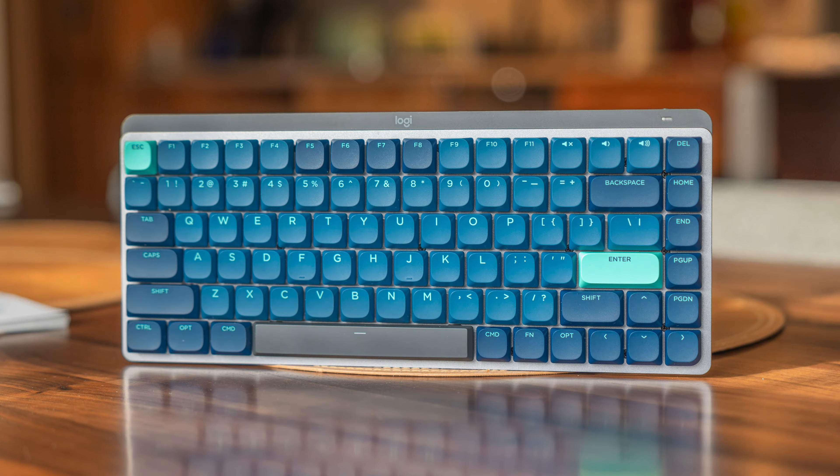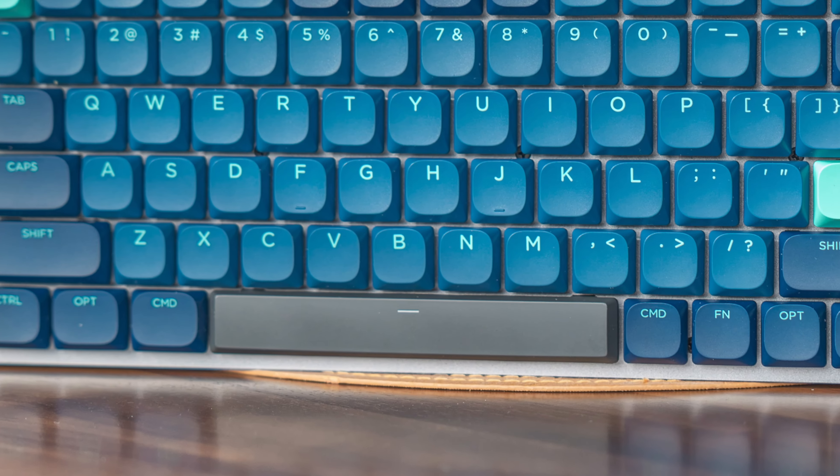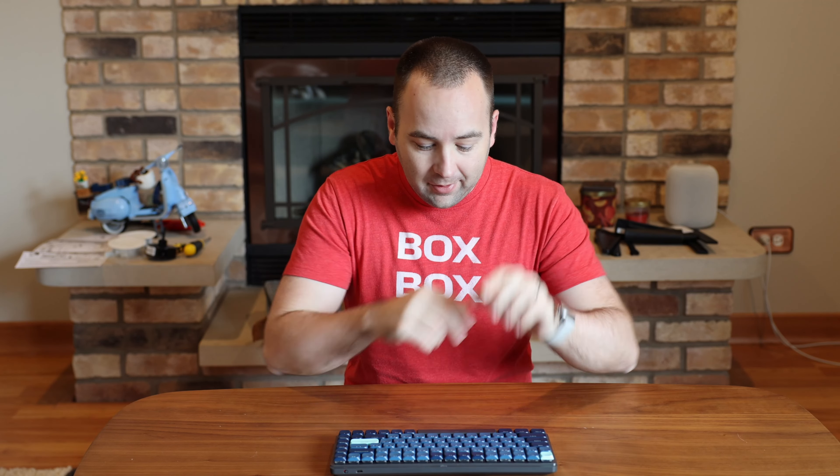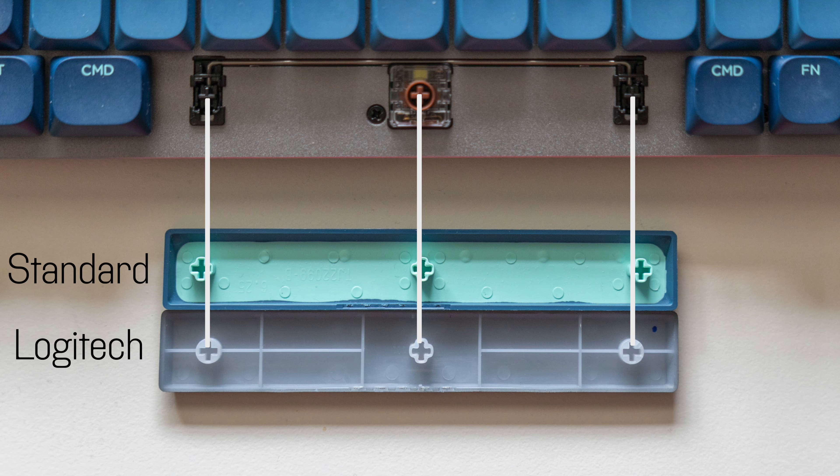Maybe you're okay with the switches and just want to change the keycaps. I've changed the keycaps on here, and it makes the keyboard look a little nicer and more to my personality — but if you look close, the space bar is not quite matching up with the rest of the keys, because you can't really change the space bar. The stabilizers underneath it are not standard, so when you buy a new keycap set, every key goes on fine except the space bar. The space bar and stabilizers are a little too close together for normal key sets, so it's just not going to fit.